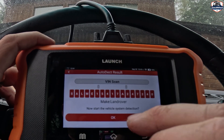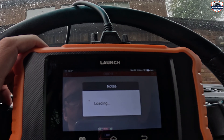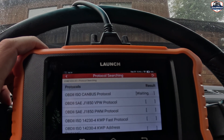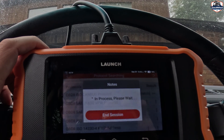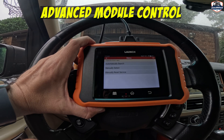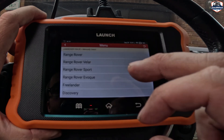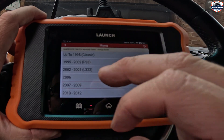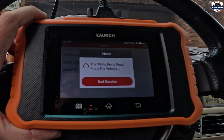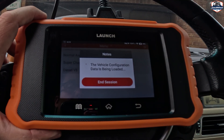What I want to do is go to very specific things in here. You can do your typical OBD2 scans by looking at specific areas — say if you have a check engine light on, you could run the diagnostics, or you could run into specific protocols. This is going to run your OBD2 scan — I'm going to say all and just let it run. Since this is a Land Rover and it has the Land Rover module, I went ahead and used it. I can go into manually select: Range Rover, 07-09, normal V8. This will run the scan that's very specific to the Land Rover, much like what you just saw in the diagnostics section. It can either auto-detect or you can force it to run like I'm showing here.